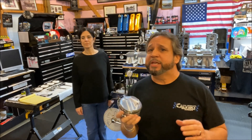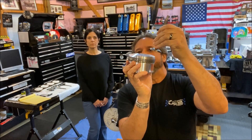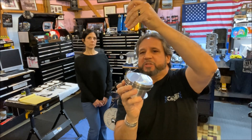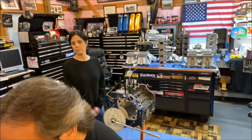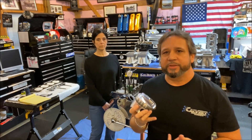You try to put it in as close as you can to that 106, because that's where the engine is making the power. That area we're changing is when that piston is closest to the exhaust valve — the piston coming up on the exhaust stroke, the exhaust valve is closing, the piston is chasing it. Then when it flips and starts drawing off the intake valve, pulling in the air-fuel mixture, that's when they're closest — 10 degrees before top dead center and 10 degrees after for the intake valve. That's the period we're working with when degreeing the cam.